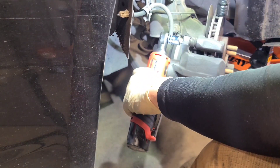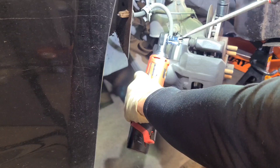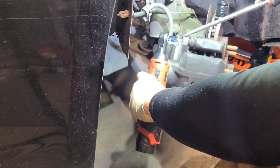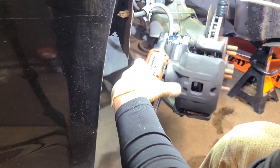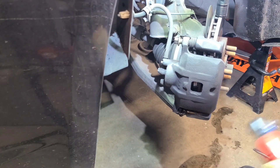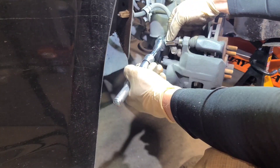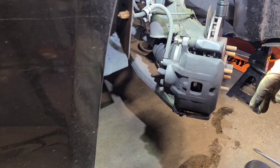This one is still spinning on me, so I'm going to use my screwdriver and push it out while I continue to rotate. I just hope we don't have a stripped caliper. I'm cocking my wrench trying to help guide it out, but this one's just spinning in a circle. Somebody changed these pads recently — let's see what's going on inside.